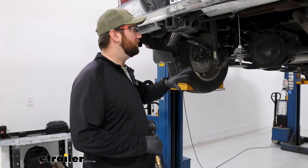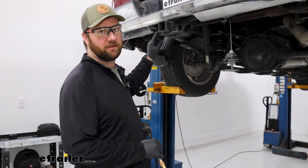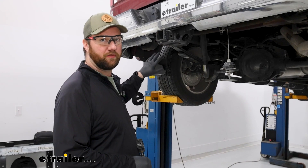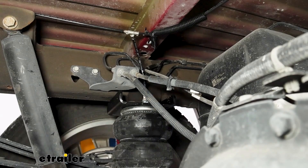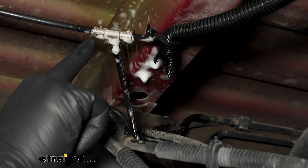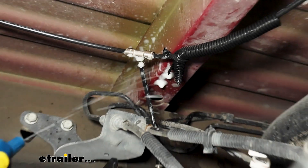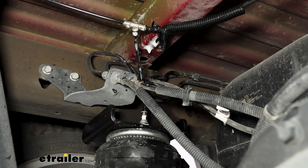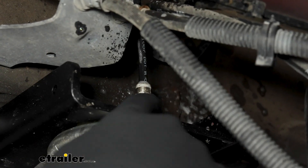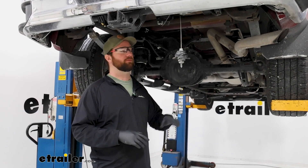With all lines run to the airbags and compressor, put air into the fitting at the back — pump it up to about 50–60 PSI — then take a bottle of soapy water and spray all connection points to check for leaks. What you're looking for is rapid bubbles forming around where the airline connects to the fitting. You may see some bubbles from the spray nozzle itself, but watch for new ones forming, which would indicate a leak.